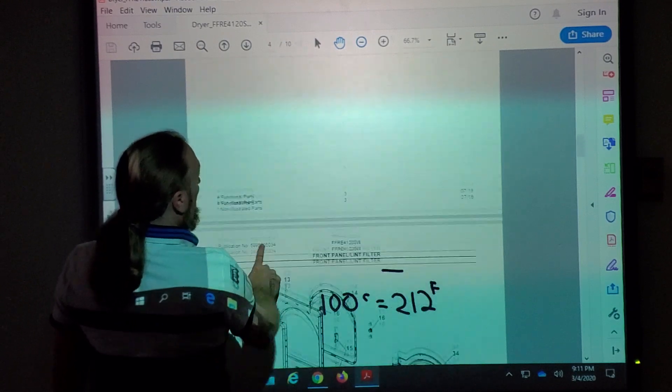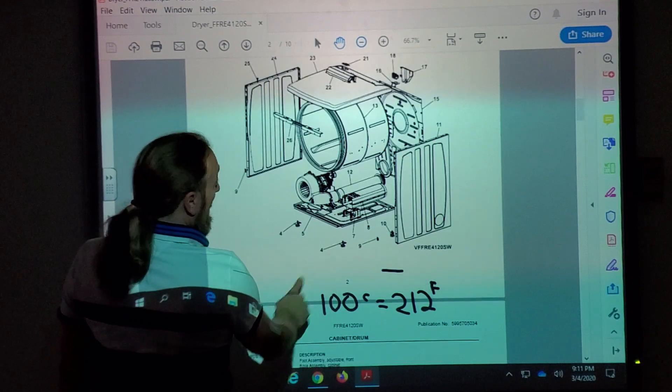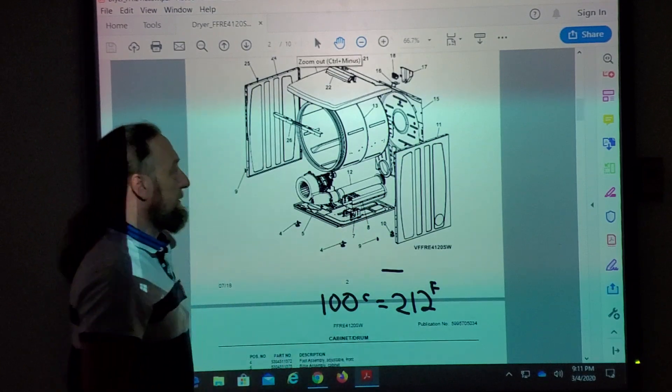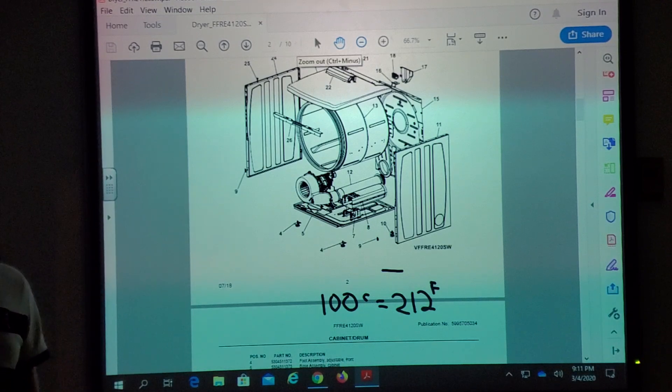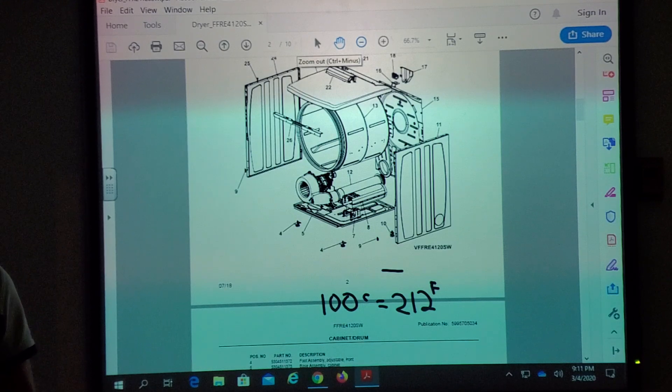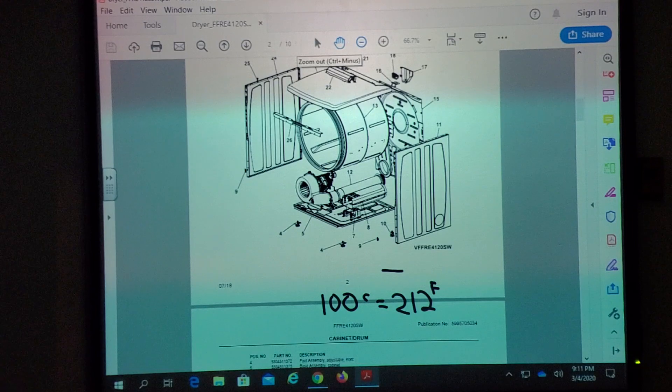This is the front, so if we look at the back of the unit — the heater's down in the bottom, like the Samsung. Now that's not normal for most dryers. They do have that on the Electrolux dryer, which is down in the bottom, but the older Frigidaires had a round circular can behind the drum.